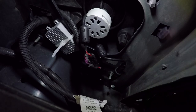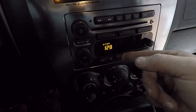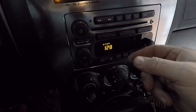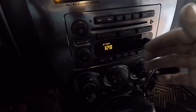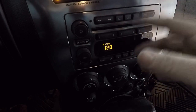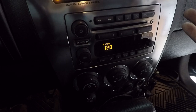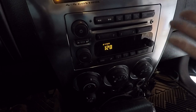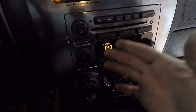So far I've got three on each. I think I've got it nailed down — the fog light ones, when I leave just the parking lights on, which are not LEDs at all, and I flip the fog lights on and off, I don't notice any difference in the radio. So I think I've got it nailed down to the headlights. There's only one more wire I could possibly put one of these things on, so I'm gonna give that a try.